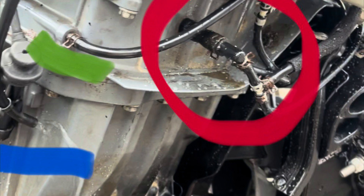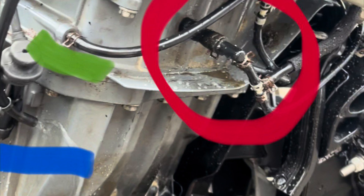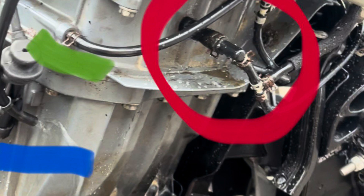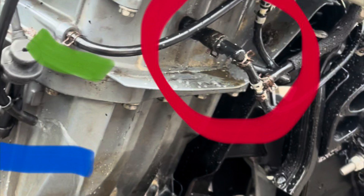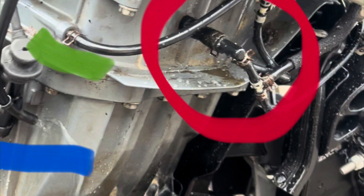I just wanted to verify this for y'all: the water coming out of the red port out of the midsection is what feeds your cooling system. On the earlier models the intake had a cooler on it, the VST has a cooler on it, and the fuel rail has a cooler on it. Also the crankcase has a cooler on it, and they all use this small black line. The output is coming straight across from where the hose is plugged in, so that water is not going into the block — it goes through those items and then comes out through the green and the blue line.